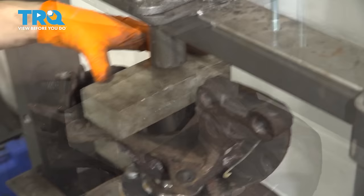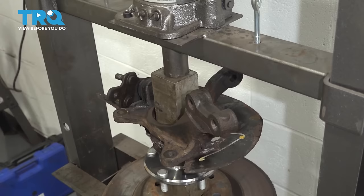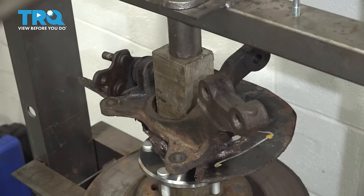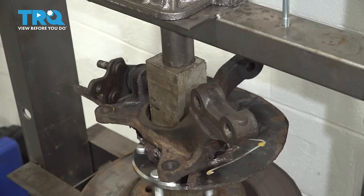There are other ways to do this, but be creative. To hold the inner race, I ended up using a spacer block that fits perfectly on that inner race. Now I'm just going to press the knuckle down into the hub. It's going very easily, which is perfect. If it's difficult at all, you want to stop and see why it's not working. Make sure you're going nice and even and straight — you don't want this going in crooked.